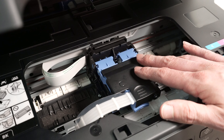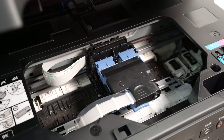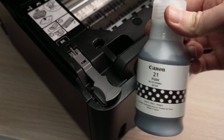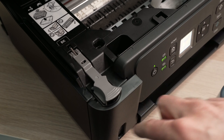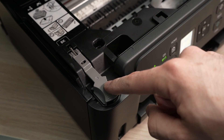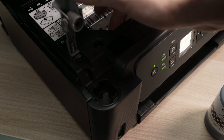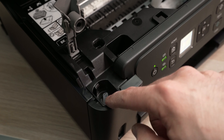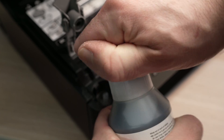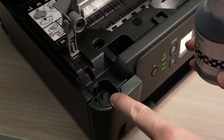This was how to install print heads in your Canon PIXMA Megatank printer. Now let me show you how to install the ink bottles. Let's start by loading the black ink first. The black ink compartment is located on the left side over here — it's separate from the rest. It has this gray lid; you just have to take your thumb and flip it up to unveil where the tank can feed from the bottle. Then take your bottle and open it.